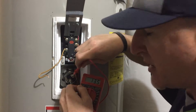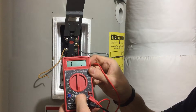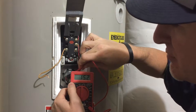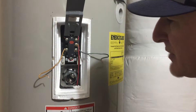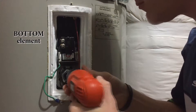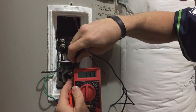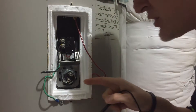So that's about right — about 13. You want to set your ohm meter to the 200 setting on resistance, so that it's sensitive. I should be reading about 13 or 14. So that's a good element — that's not the problem. Same thing applies to the other one. As expected, that one's good as well. So both of the elements are good.